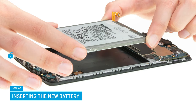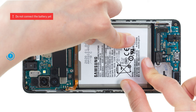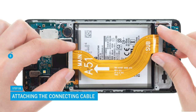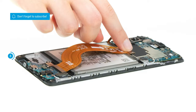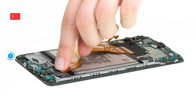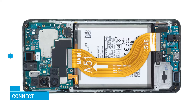After removing the protective film from the back of the replacement battery, you can put it into the device and press it firmly. After that, position the connecting cable over the battery — the cable labeling will help you align it. Attach its two connectors on the USB and motherboard; you should hear and feel them kick into place. Be especially careful when attaching connectors and never press them down with force. A damaged connector can lead to the failure of an entire component.